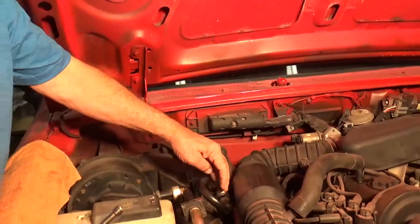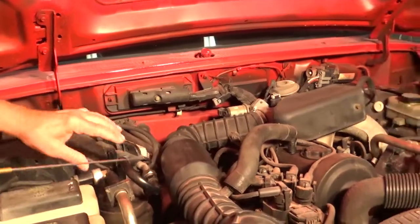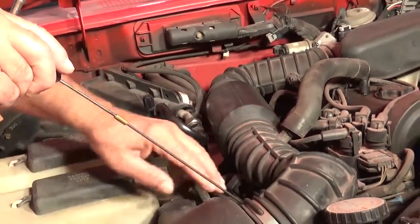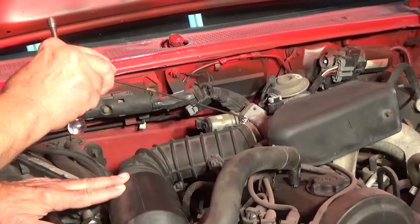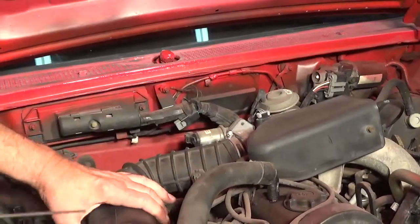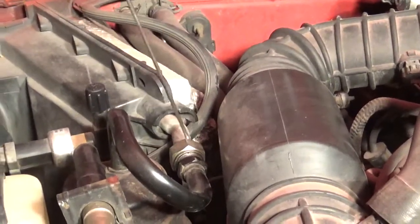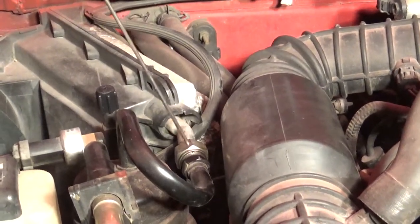Some of them it's a little further apart, but in order to get in here to these parts, I'm going to use a pointer. This is the air intake. There is a band that locks it to the filter over here — there's a little 5/16th nut on it, and another one over here. Take them both loose and simply pull this up out of the engine. It slips right off — move it over out of your way. Gives you all kinds of room. It's awfully tight, and you've got to have a pretty good size wrench to get in there to that nut.